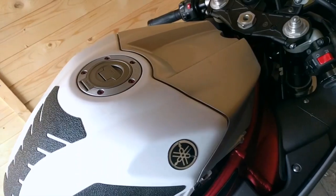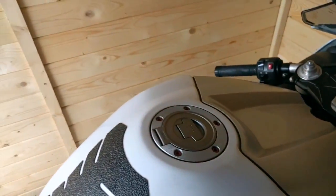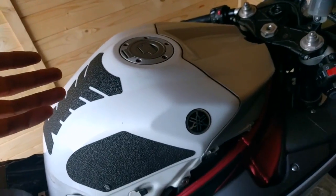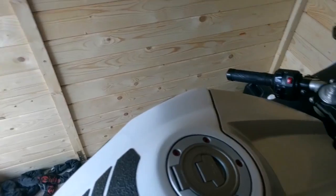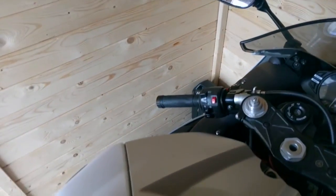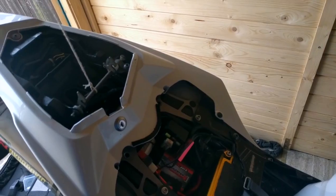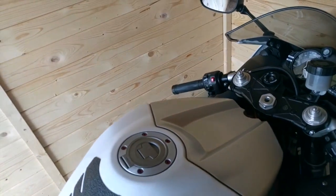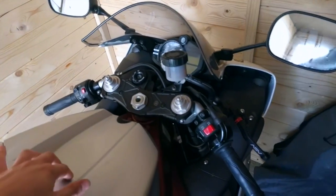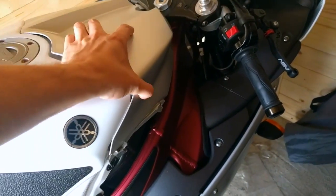My advice - unlike some of the weird stuff I've seen on YouTube recently - don't undo these first. Unscrew it at the top. What I normally do, because I can't be bothered to take petrol tanks off, is a makeshift pulley - run something through this hole up into your ceiling, or in my quick hack, a bit of string tied to the rear seat lock bar. Pull it up. Undo the top nuts first, because as soon as you've undone those, this is no longer attached and you've got nothing to hold the tank up with. Then undo these and it just comes off, like so.